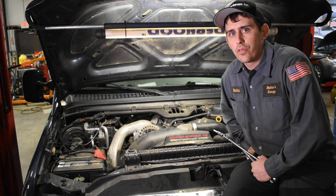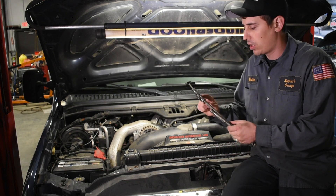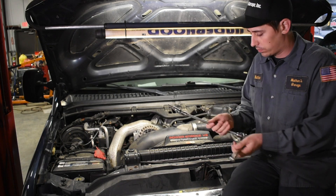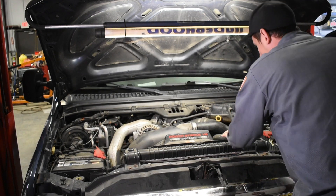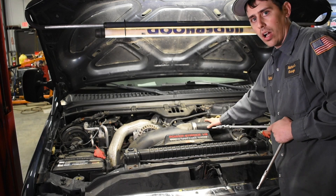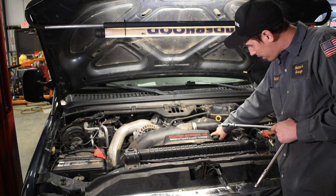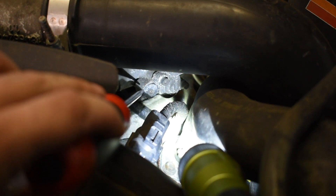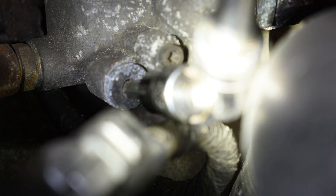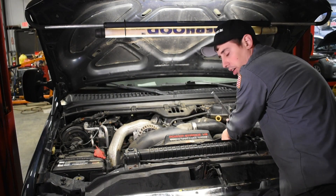The first thing we're going to do is install a fuel pressure gauge. To do that you're going to need a 6mm Allen with a swivel and a little bit of an extension. You can go right in here under the black intercooler pipe, or on the '03s you have that metal pipe — look under it, and right on the front of the fuel bowl there's going to be a little port. Sneak in with the extension and just take that plug out.